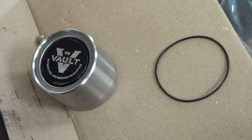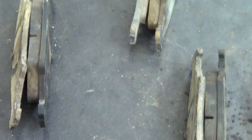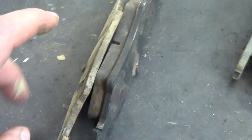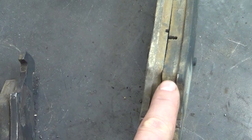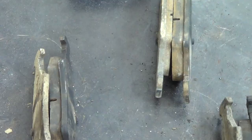Now let's look at the brakes. I decided to inspect them specifically because I heard a scraping sound, and you can see there's no brake pad at all left on this one. The 20,000 miles was almost all highway and freeway driving — I was not doing much braking at all. This one, one side is pretty much gone, the other is starting to show a little wear. Across the brakes, one side is almost as new and only one side shows wear, which implies the disc brake caliper is sticking — not sliding well on its pins.